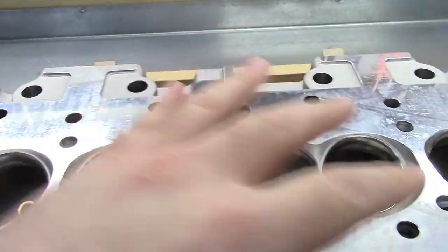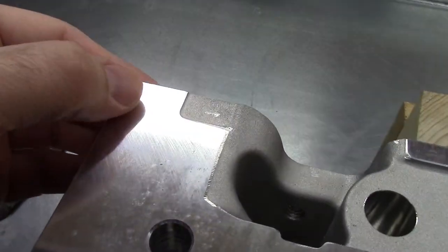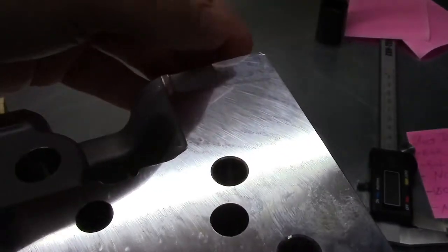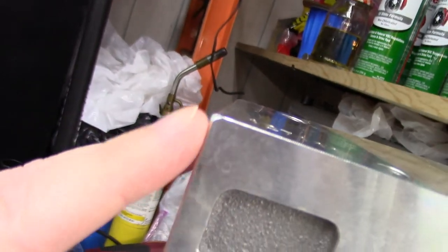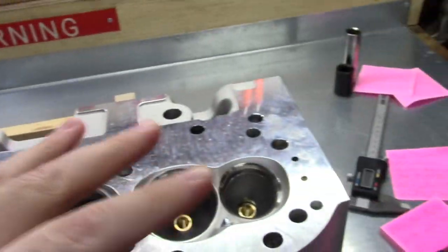They were all on the deck side, so we'll start off right here on the corners. There's a bit of a dented lip, more so on this side. That's an easy fix — just file them right down. You can see on the old casting it appears it's already been filed off. Not a big deal, but a small finishing defect.